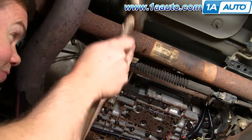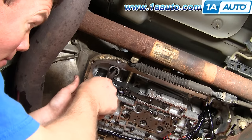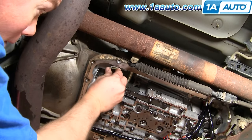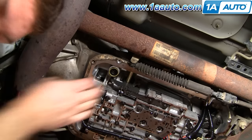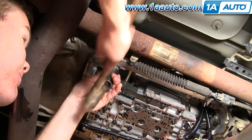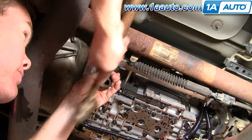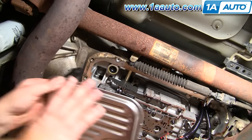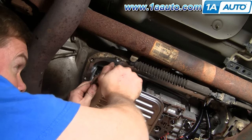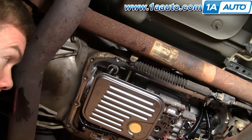Be careful not to scratch the aluminum on the transmission. You can see here using the pliers and pulling the grommet right out. Now reinstalling the new one that comes with the filter — push it up in there with your thumb, then take a large socket and your hammer and drive it in nice and straight and flat. Now you're ready for your new filter — just push it up in there. The transmission sucks fluid through the filter, so nothing but suction and that grommet hold it in.